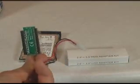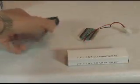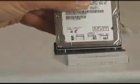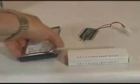It has a power connector here to supply the drive with power. By looking at the device settings here on the drive, we have installed this very small jumper to indicate that the drive is going to be configured as a slave. The C drive in the machine will continue to be the primary IDE drive, and this laptop drive that we're trying to recover data off of will be a slave.